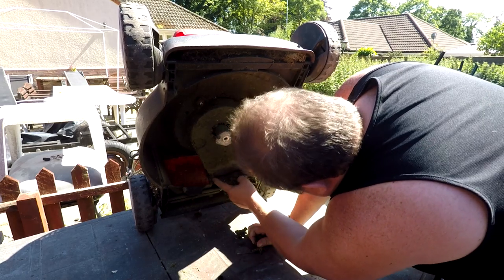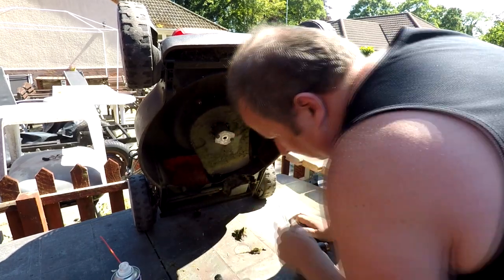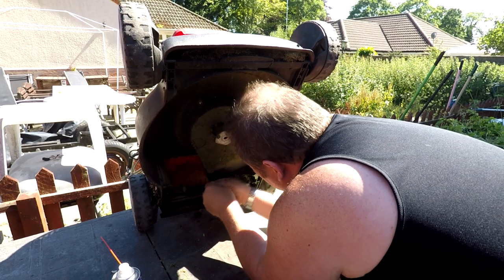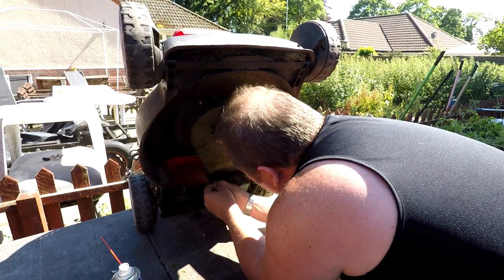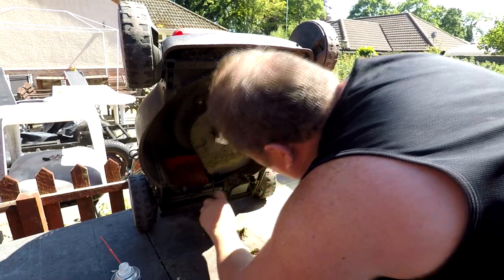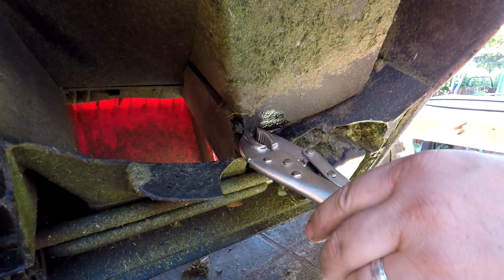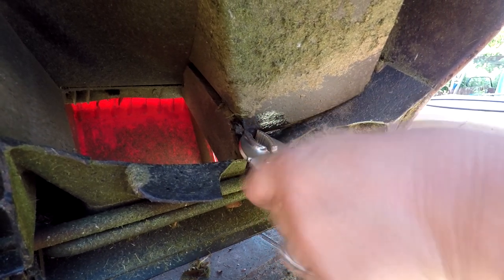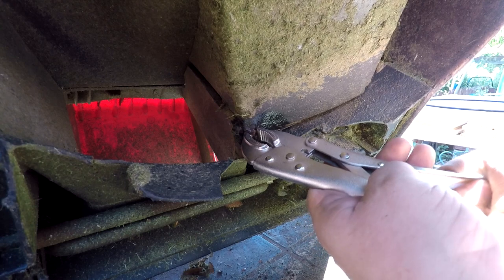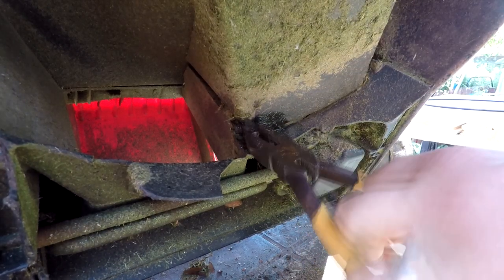There's normally another screw at the back here which is a Phillips screw. These tend to be very corroded, nine times out of ten, and sometimes you can't even undo them — you have to grip hold of them with a pair of mole grips or something like that. I think this one's rounded off so I'm going to get some mole grips. Just get some mole grips on here — normally give it a bit of a wiggle to loosen it off. Little things like this can take ages to sort out but you've just got to persevere. It's only a self-tapper.